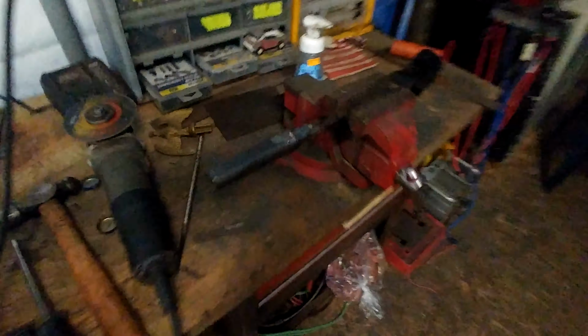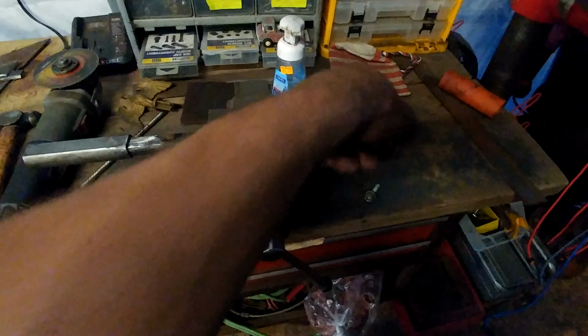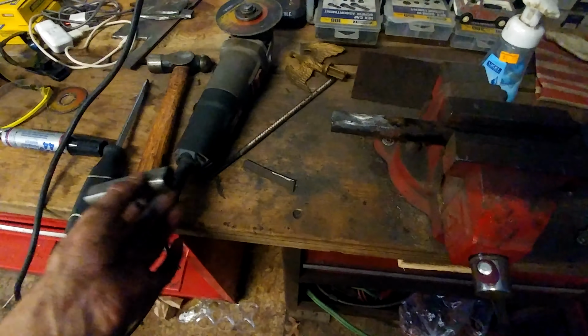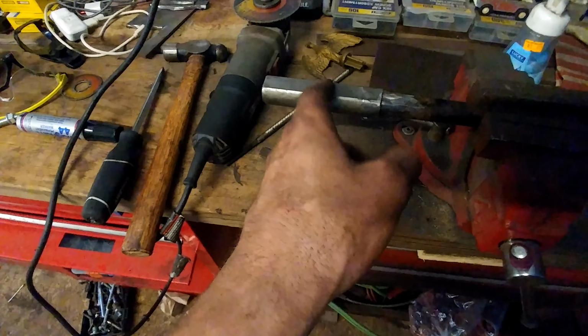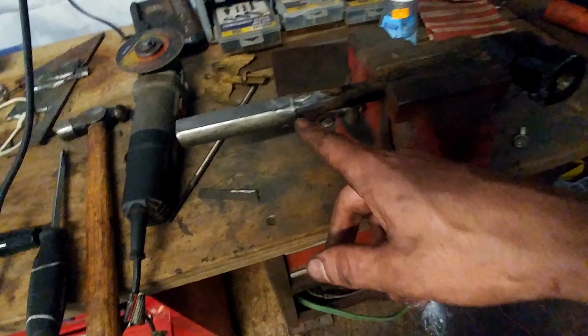We used a Jeep Cherokee late 80s early 90s shaft with this double-D joint, and then we lopped it off, and then we cut the factory GM one and used that chunk of it, because this was too clunky and it's got this stupid crap on it. I don't know the technical term for that. So stupid crap is the technical term.